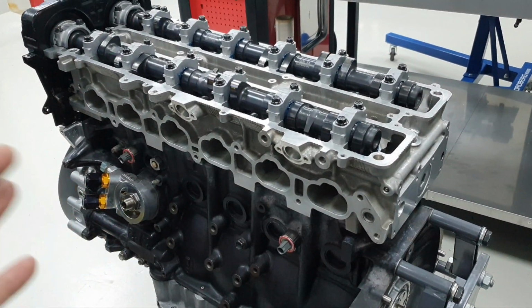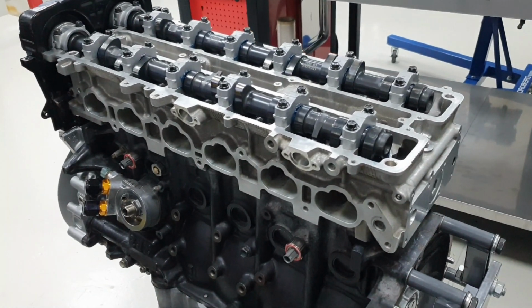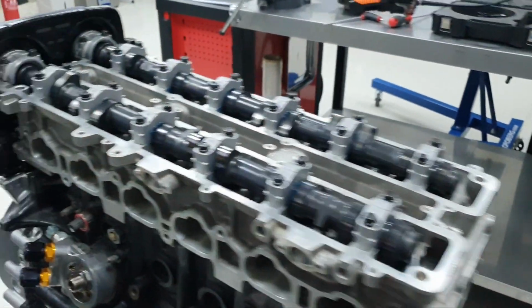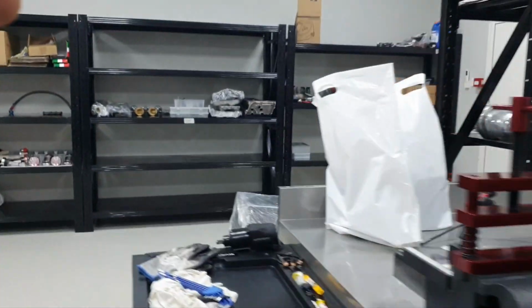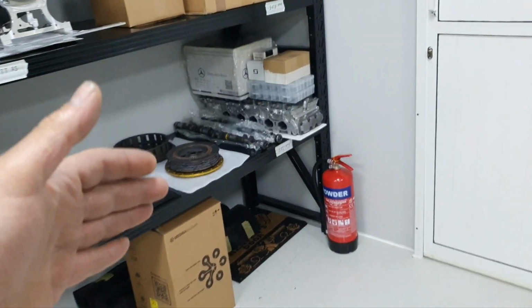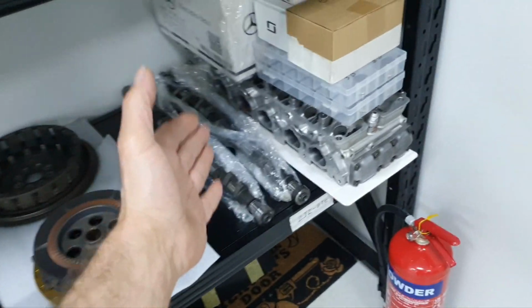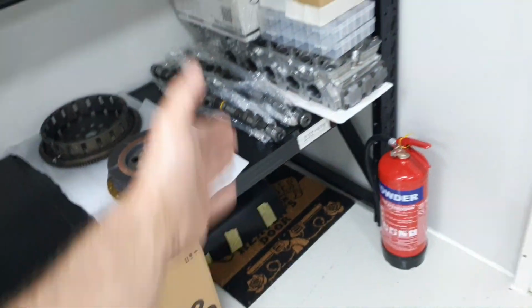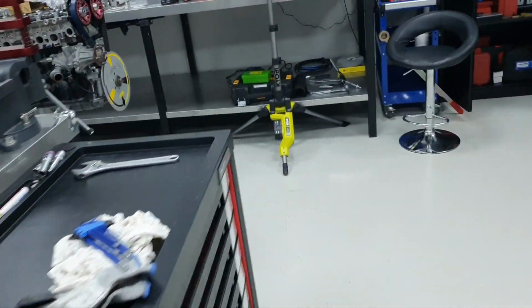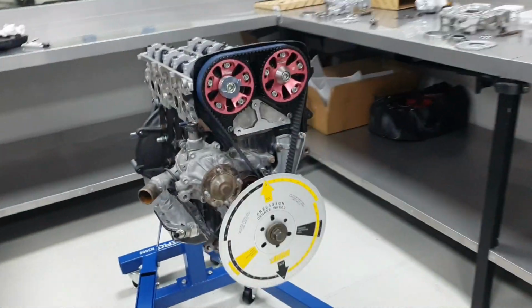I hope not to have any headache with the tune, or with the wheel spin, and to be like the other camshafts over there. I'm talking about this one. They are not straight, these camshafts. They're not ground properly, if you're asking me at least, these two I'm talking about, and one is bent. Yeah, the exhaust camshaft is bent.